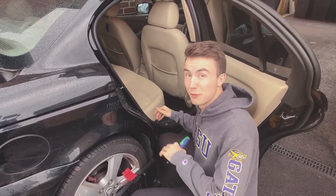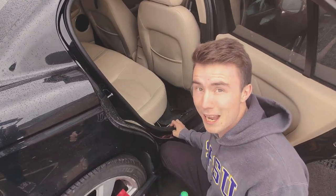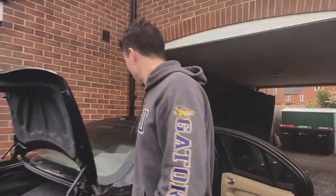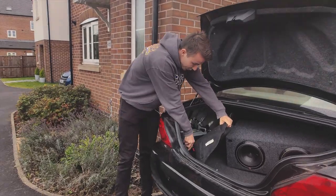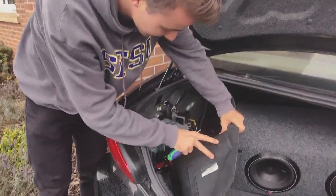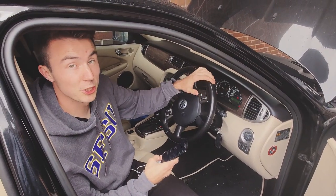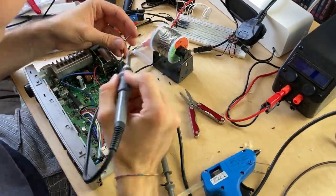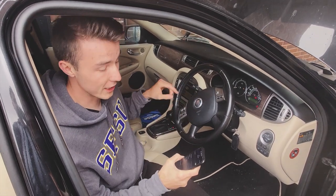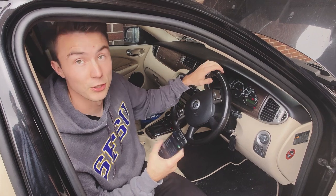The speaker box is finished with the logo in place — now we just have to wire it in along with the amplifier. In older cars like this the head unit won't have a subwoofer out, so what we have to do is splice into the rear speaker cables, solder them, and run it to the boot where our amp sits to get our audio line. There's also a channel called Jagdroid which shows how to fit Bluetooth to your car in a module — I've wired that in and connected to my car so I can get Bluetooth and tunes going through the head unit.